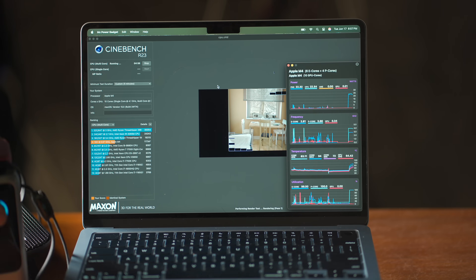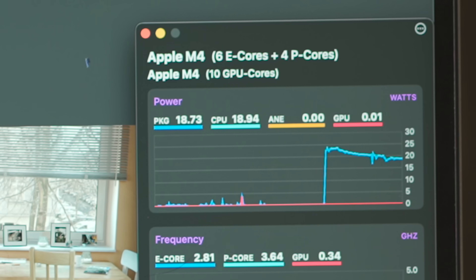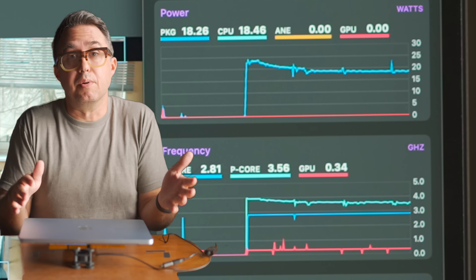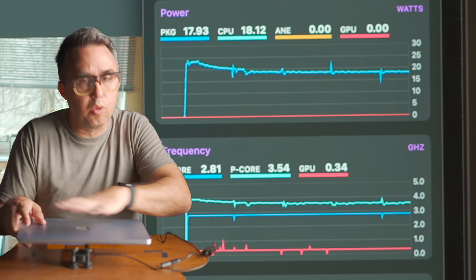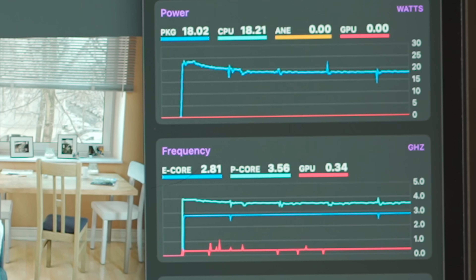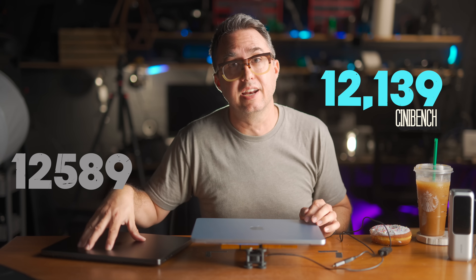Here are the numbers. There was real early confidence when I saw the power level hovering over 20 watts for the first entire minute of this test — in the previous tests, the watts number had dropped into the teens just a few seconds in. Then it stayed between 3.5 and 3.6 gigahertz for the entirety of the test. Remember, the default MacBook Air had to slow all the way down to 2 gigahertz flat to stay under its heat threshold for throttling. With this new configuration, it was able to keep pulling between 17 and 18 watts throughout the whole test. The baseline Air had dropped to 7 watts just halfway through. This is an enormous change, and it ended up scoring 12,139 points on Cinebench. MacBook Pro again: 12,589. We're down to a 3.5% difference now — 12,139 is a lot closer to 12,589 than 9,500 was.